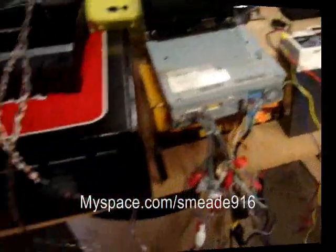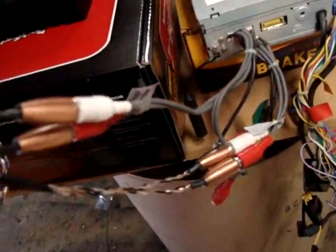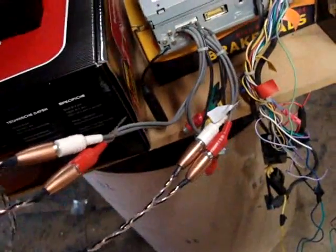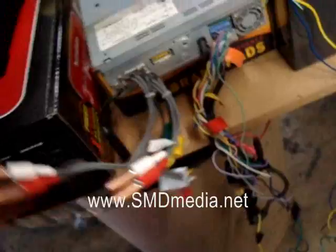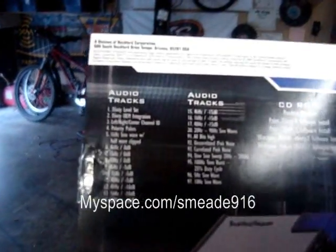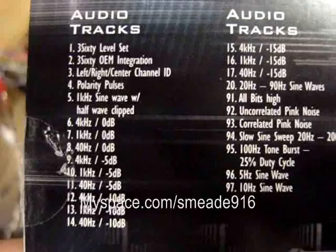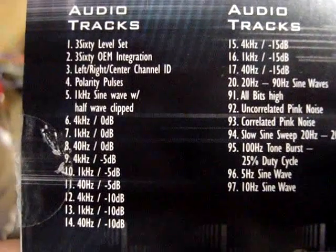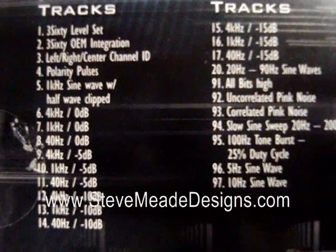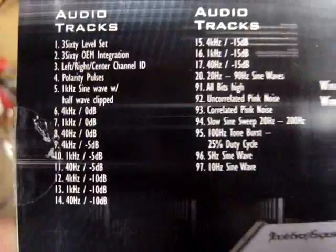Let's go dig in this pile of RCAs, see what all I got, get it hooked up the rest of the way, then we'll start this up. The first part of this demonstration, we're going to show you how to make sure your deck isn't clipping, because that's the first thing you want to start with. If your deck is clipping, everything else behind it's going to clip too. I've got an RCA hooked up to the sub out and to the front out. A good place to start would be 1000 Hz at minus 5 dB for the mids and highs, and minus 10 dB at 40 Hz — measure your subwoofer with that.